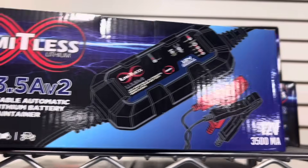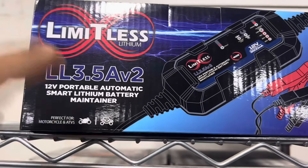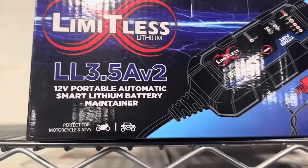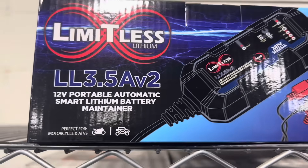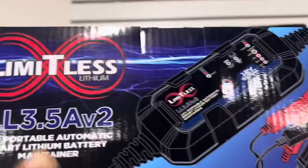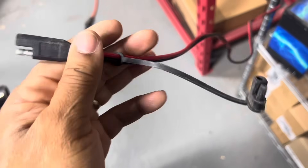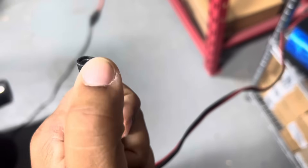Here's the Limitless tender — it's only 3.5 amps, which is not a lot. For example, a 3000.1 or Full Tilt amplifier will draw over 200 amps of current. So if you have 3.5 amps going in while drawing 200 amps out, it's going to drain the battery really fast, then override the fuse and blow it — or destroy the maintainer if plugged in through the tender plug. These only support less than 10 amps. You can tell by how thin the wire is. I've had clients melt the plug so bad that the prong actually fell off.